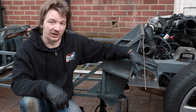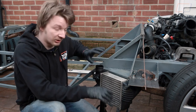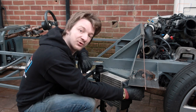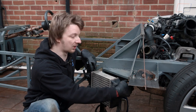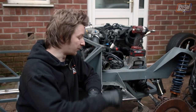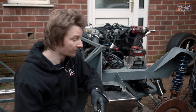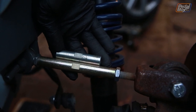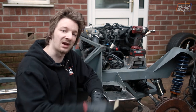Now that we've modified the receiver hole on the trailing arm mount we can fit the trailing arm itself and figure out whether it's getting in the way of our intercooler pipes. If we put the intercooler just up here it seems great, but the boost pipe ends up inside the bottom half of the trailing arm. Thankfully it's not hard to solve - if we move the intercooler forward slightly we can still fit our elbow in front of the trailing arm and run our crossbar to the other intercooler without getting in the way of anything. We noticed that correcting our toe by moving the front mount outwards messed with our rear camber quite badly - one of the joys of a multi-link suspension system. The fix is replacing our very short upper control arm turnbuckle with a longer one - going from a 70mm insert to 120mm - giving us up to 50mm more length on our upper arm to fix the negative camber, clear our spring, and get everything back into correct geometry.